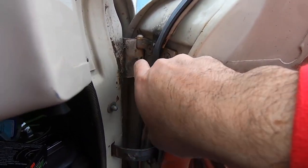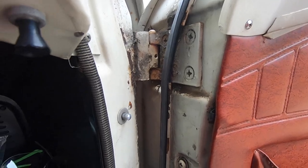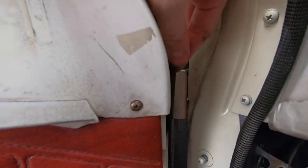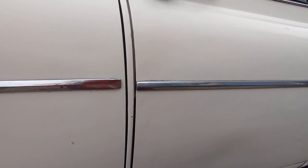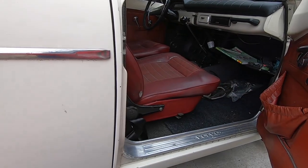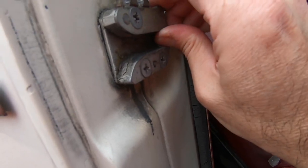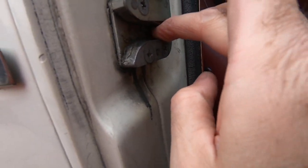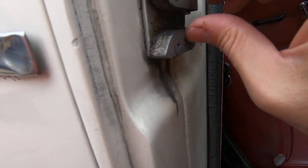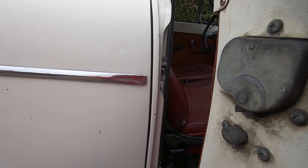It runs all the way through the door hinge and that's obviously what's keeping it from closing — it's just hitting this. Direct comparison side to side looks about the same, but the old one is just so smashed that it's able to lie flat. It turns out it wasn't the hinge — we had a mechanism problem. This thing wasn't sliding all the way out because there was a buildup of wax. You're supposed to keep it paraffin waxed but this was a sticky gross mess, and this little pin down here needs to slide.